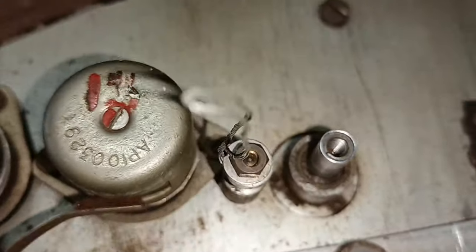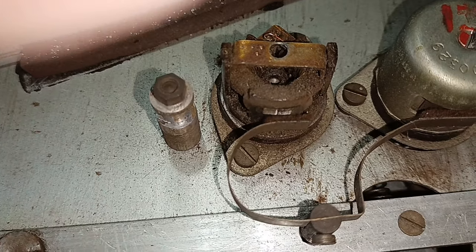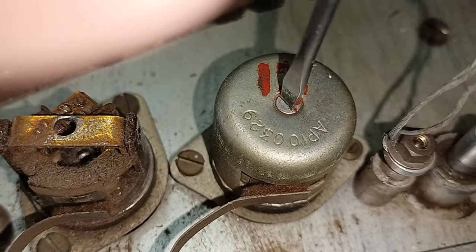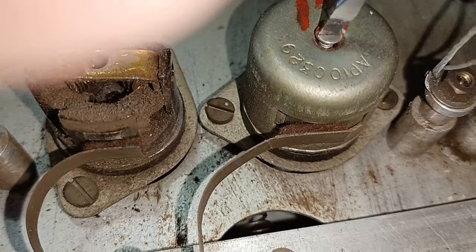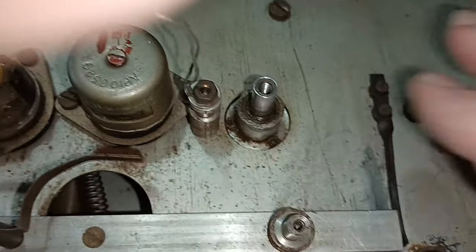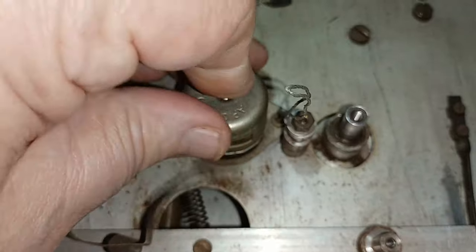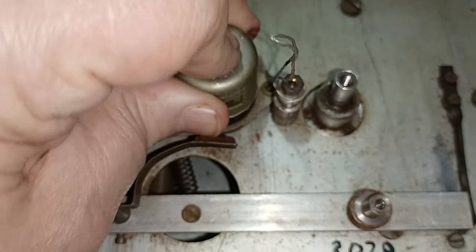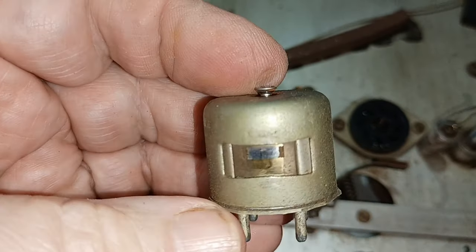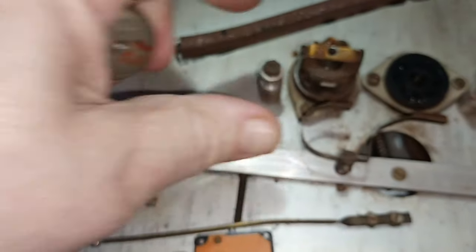This is the erase head. You can see here it looks like a diagram of an erase head — you've got a magnetic core, a soft iron core, and you've got coils around it. And that is all there is to it. It is literally the way we draw them. Next to it we've got the record head. My dad put an earthing strap onto it to the main tape guide there, because there seems to have been a bit of hum. You can see the sleeve on the capstan — he had it machined so he had a four-speed, rather than just the two-speed it originally came with.